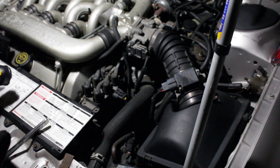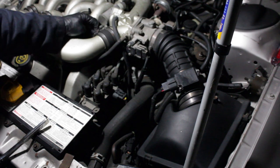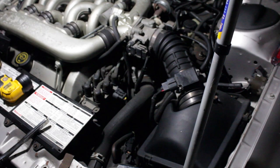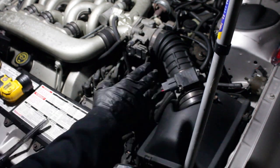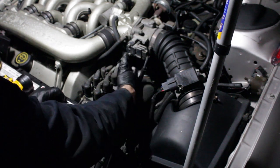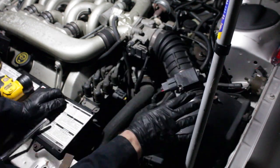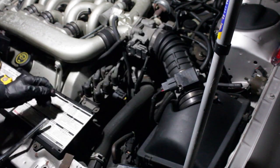That's it down in there — we want to pull that connector off and then we're going to run some tests on it to see if the sensor is bad. You don't want to just replace sensors because nothing hurts more than buying parts you don't need. I'm going to go ahead and remove the air box at this time too to create even more room. I think the best way to get to the sensor is actually going from back here rather than between the distributor and the coolant line where the thermostat is. So let's take the air box out and the hose that connects to the throttle body.